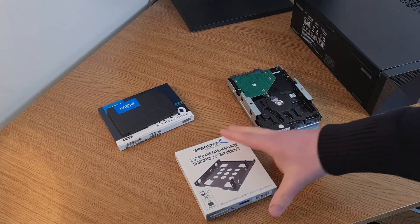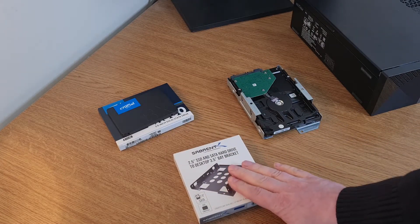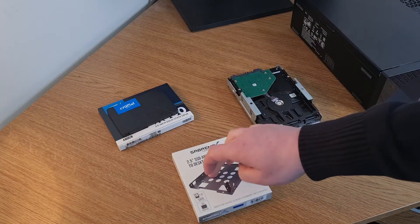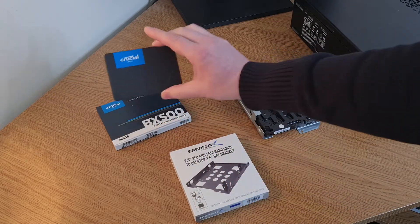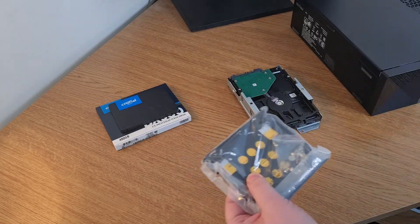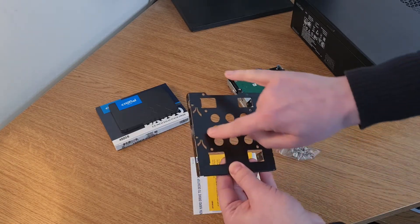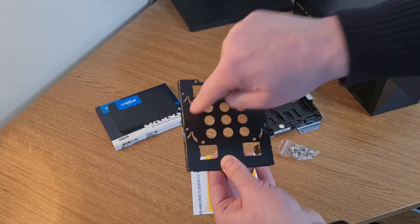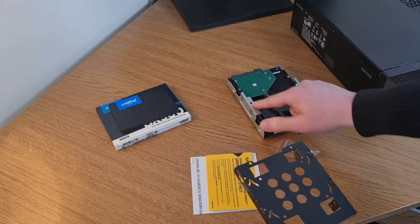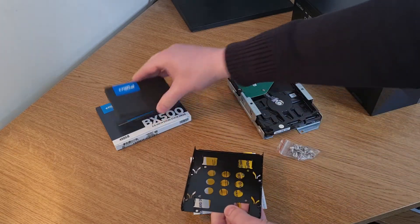It's a few days later and my bracket has arrived. One of the things we need to be aware of when ordering a bracket is that not any kind will do — because of the way the old hard drive is fixed with vertical screws, I needed to make sure I got a bracket that could do the same in order to hold this SSD. What I can see here is we've got holes in this vertical plane, meaning it can be correctly attached into the silver bracket that's the original part of the Dell machine. So let's install this two and a half inch drive into this three and a half inch adapter.